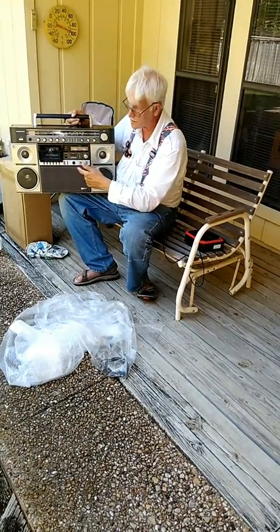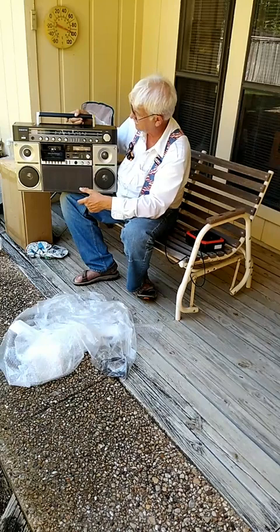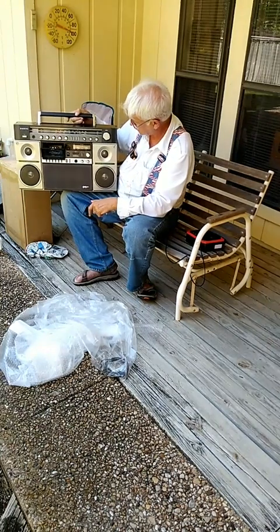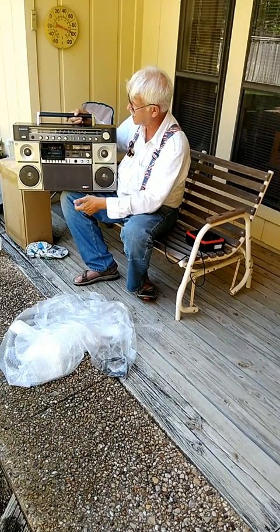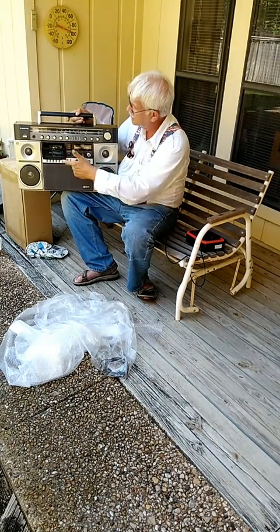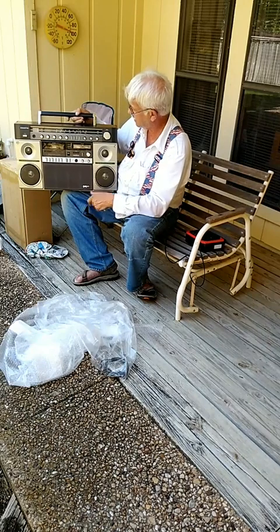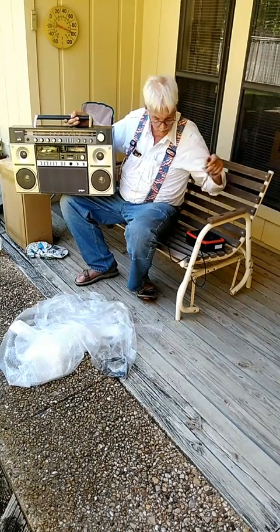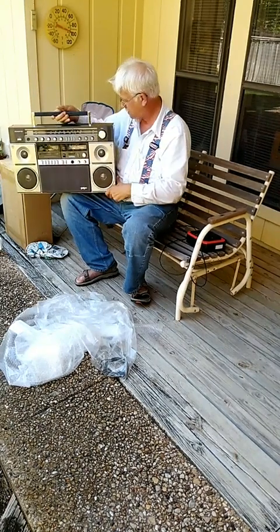It doesn't work on this model because, as I know, the tape deck didn't complete its cycle and thus the power switch won't work properly. And that's all I'm going to say there, because I'll go in here and fix the cassette deck and then I'm sure the power switch will come back to working properly. With the Sanyo models, on some of the older ones like this one, if the cassette deck didn't complete its cycle, it doesn't turn. Well, it's hard to explain, but I'm sure that's the issue. So I'm going to stop here because I can see that none of the cassette deck reels work, but the radio works as you heard it. And I'm not going to sit here and play the radio all day because I have more to do. So I'm just going to unplug that. All right. Turn this off. Where am I going to place this? I'll just place it here.